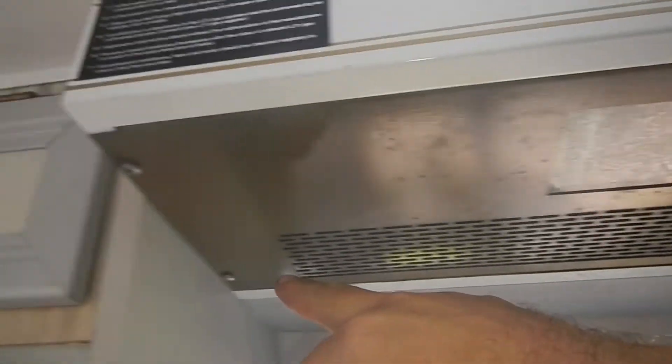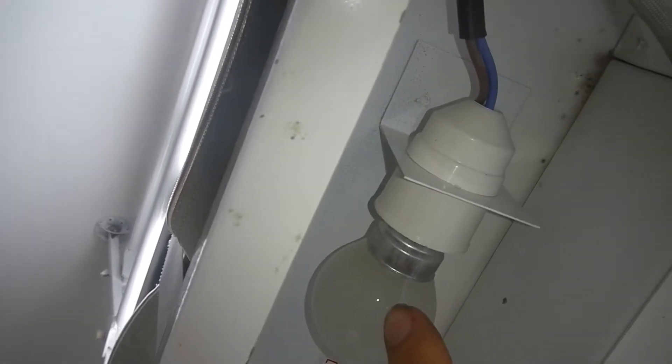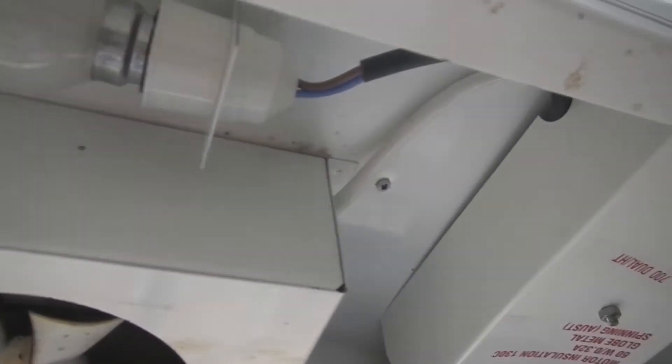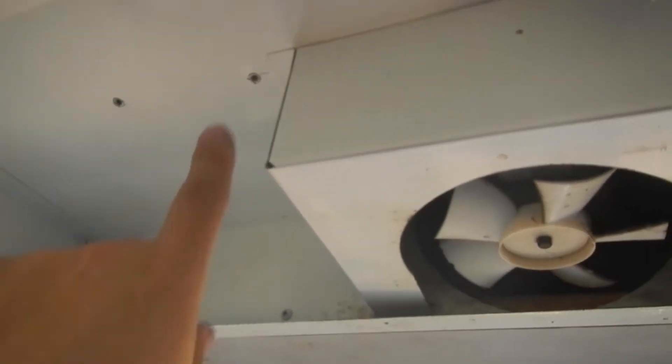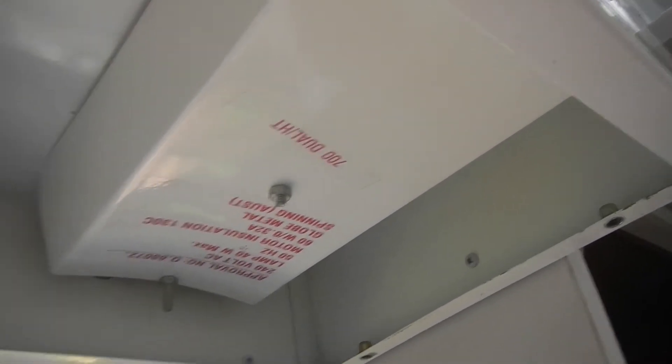Now we're just down to taking out some screws — we've got four on either side of this plate. This is the back section of the cover we just pulled off, the grill section, and the little light section. Up inside there's not much to show — we've got the 240-volt bulb and the fan. In relation to the screws, one up there, a number along the back, another one on this side, and a number along the top as well. This may be common sense, but leave a couple of support screws — get to your hard ones first, like this one in here and this one up here. Pull all the hard ones out first and just leave yourself a couple of easier ones, so you're supporting the weight when it drops and you're not in an awkward position trying to pull a screw from the side. Leave yourself a couple of easy screws as support and then take those out last.